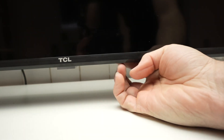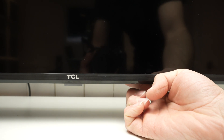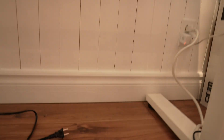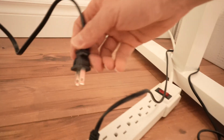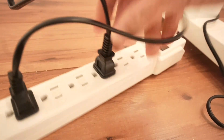Mine is right over there on the right side — that's the power button. You're going to keep it pressed for 30 seconds. Even if the TV is unplugged, just keep your finger there for 30 seconds. After 30 seconds, release that button. And once five minutes has passed, go ahead and connect the TV back to the power socket.